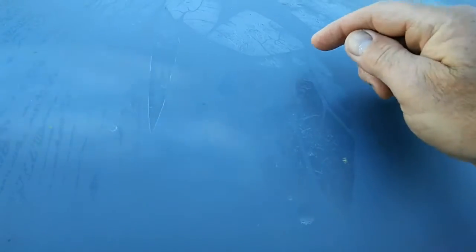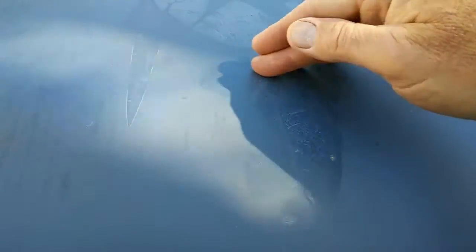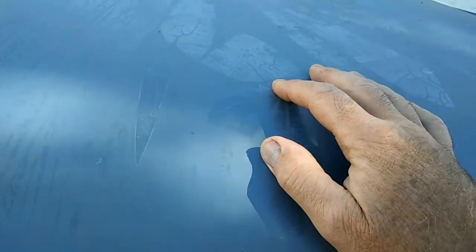So this you need to repair, and the best way to repair it is like this. You'll see a rust spot right here. It'll be about right in here somewhere. Just go ahead and cut a square to open that area up. Pull that piece out where the rust hole is. Treat everything you can behind it with rust reformer, phosphoric acid. I usually use rust reformer because it has a finish on it. So if you use phosphoric acid, that means you're going to have to paint it as well. So treat that area underneath.